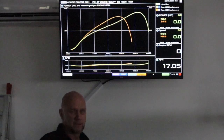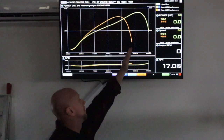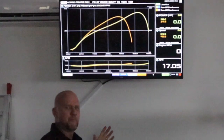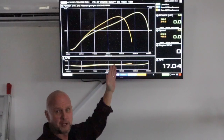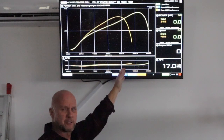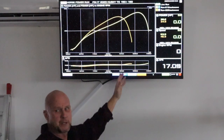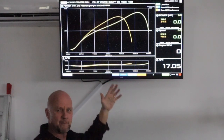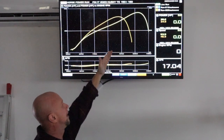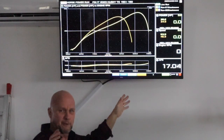Whether that's what you want to see or not, that's reality — there's a huge difference between fourth gear and fifth gear on the dyno. The RPM was calculated based on speed, and the rear tire runs faster in fifth gear, so it goes out further on the chart. Fifth gear is the one we calculated our RPM from, so the bike revs out to about 10,500 before it peters out. Fourth gear would have had the same RPM if calculated the same way, but the shapes are still different. Interestingly, it consistently makes more power in fifth than fourth — that held true every time.